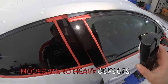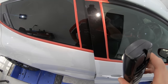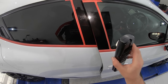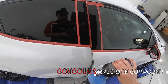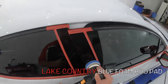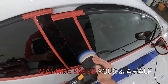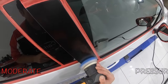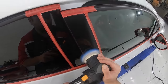In my experience, unless the scratches are super light swirls, it's virtually impossible to remove the scratches and get a near perfect finish with just a single stage of polishing. So it's almost always going to have to be a two-stage process: firstly remove the scratches with a slightly more aggressive combination, followed by a very light or fine finishing combination to clean up that compounding haze. As although these trims are soft, which means it's easier to remove the defects, it also means that it's so much harder to finish without haze or marring in the finish.